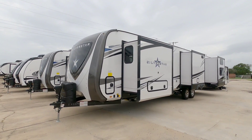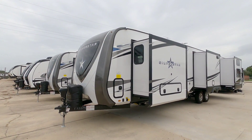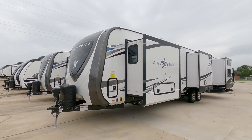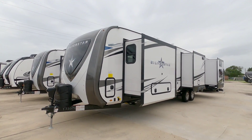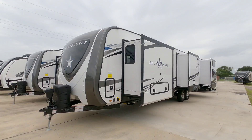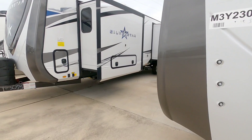In my opinion, this is absolutely one-ton single rear wheel or even dually territory. You could get away with certain three-quarter ton trucks, but keep in mind how long and tall this unit is. If you have a properly specced out three-quarter ton truck, you'd probably be fine — just make sure you're pushing upwards of 2,500 or more in payload capacity. Anyways, before we take a look at the outside, let's hop inside.